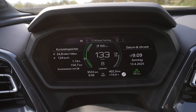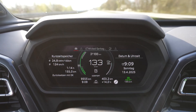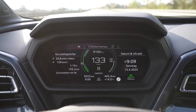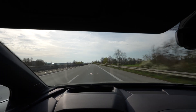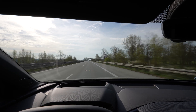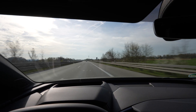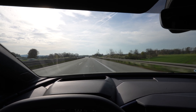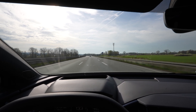I was just at 50% — drove 152 kilometers, so 304 kilometers of projected full range. Consumption is still around the same, 248 watt hours per kilometer. It's a bit warmer now, 14 degrees, and there's a bit more traffic — I have to accelerate occasionally to pass cars. Soon we're going in the direction of Munich. I'll navigate to the gas station rather than the charger so it doesn't preheat the battery on the way back, keeping our consumption real.